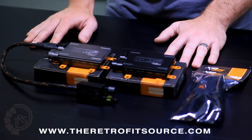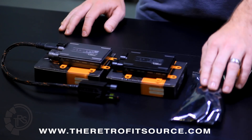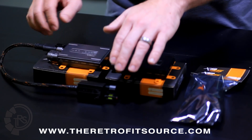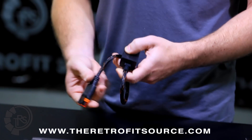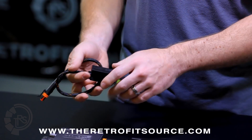You're going to have a little bit of give and take there. One of the nice things about the ballast is that the igniters are actually separate. This is kind of more like original equipment ballast. There's not really a lot of aftermarket ballasts that are like that, which have separate igniters that are also removable from the ballast. So that way, if in the rare case that something actually does go bad, we can just send you a replacement igniter and you don't have to replace the entire ballast system.